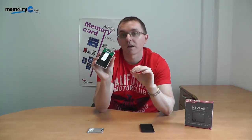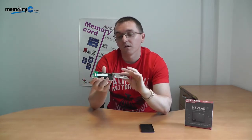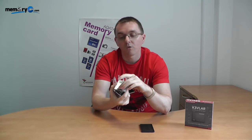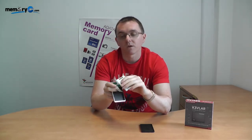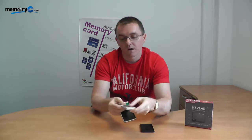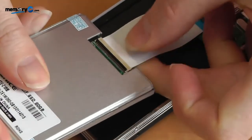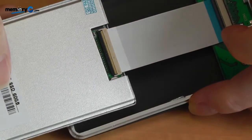That is how you correctly connect the ZIF cable to the ZIF product. The same mechanics apply with the contact connection — do not do it the wrong way, it's contact to contact. Always make sure the lever is in the upward position before inserting. Line it up very carefully, pushing in on both sides — left and right — then push down the lever to make full contact.